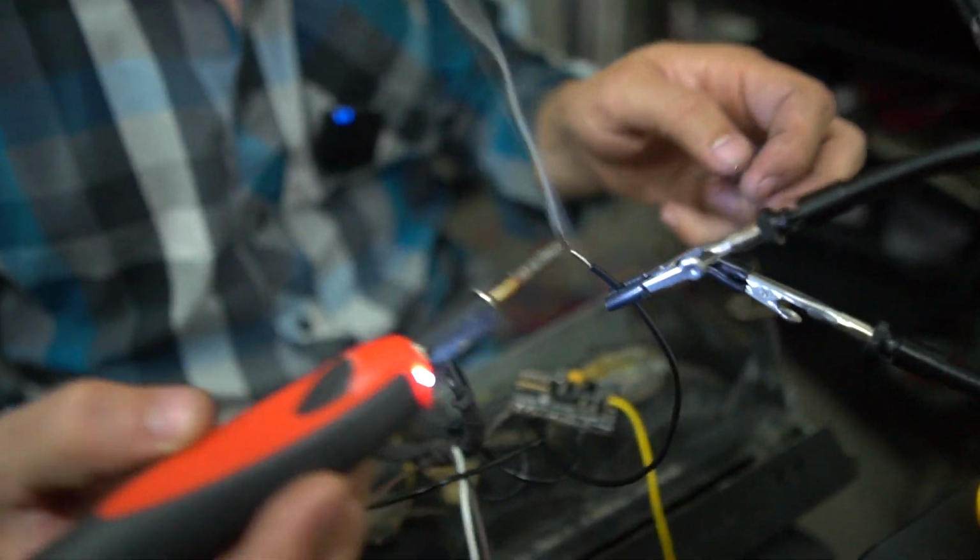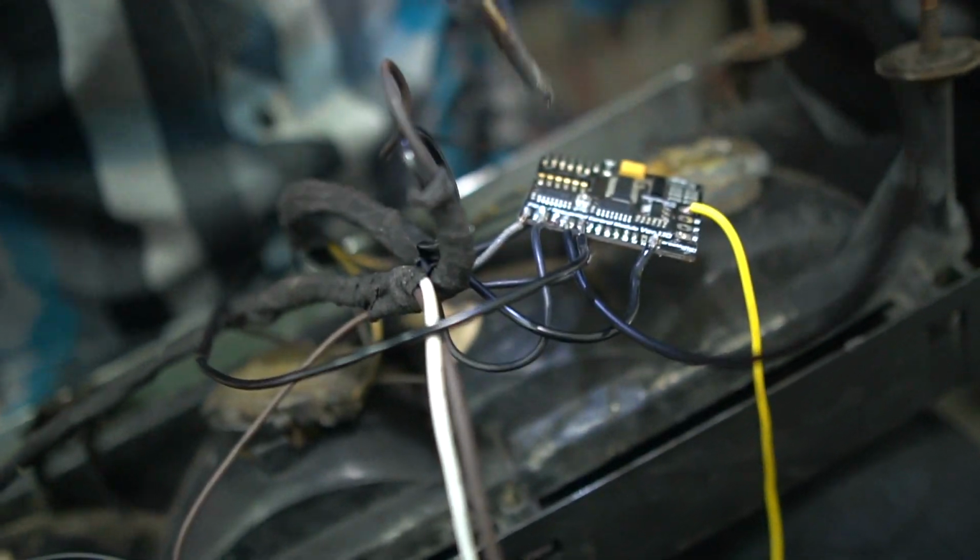So I'm soldering this wire on, and it's connected on the board to 2 outputs because it has a maximum output of 300 milliamps, and I'm powering a bulb that's like 470. So I'm using 2 channels of output to equal roughly 600 milliamps to power up a 470 milliamp bulb on that channel. You shouldn't do this, but this is how I'm doing it to solve the problem.